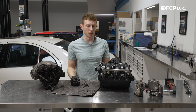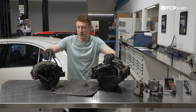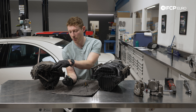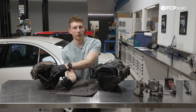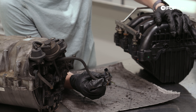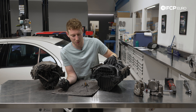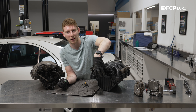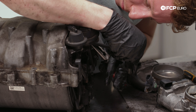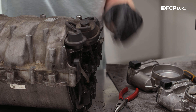Next, we continue swapping over everything from our old manifold that we are reusing. I chose to disconnect the MAP sensor, so I'm now going to pull the vacuum line off its port on the old manifold and swap it over to the appropriate relief cut on the M014 manifold — it just slides on. If you have a stock manifold it's very much the same procedure, though it may be a little trickier with the big air bladders in front. Take your time: one vacuum line will go to the MAP sensor, and the other will come from the secondary air pump.